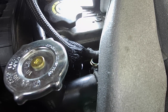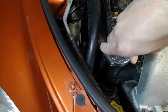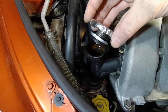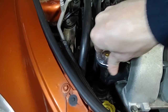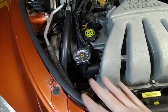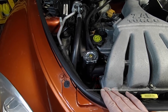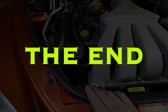Nice new Gates cap on there. It's the next day from when I filled the coolant. The level's actually gone down about half an inch, but that's such a small amount - that's just a bubble somewhere. There wasn't a single drip under the car overnight, so everything's good. The thermostat sealed up nice and the only thing left to do is bring it up to temperature and check for leaks. Thanks a lot for watching Matt's Garage. I hope you found the video helpful - don't forget to like and subscribe, and have yourself a great day.